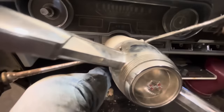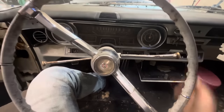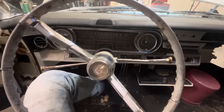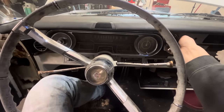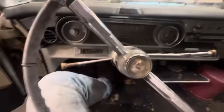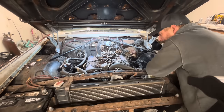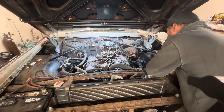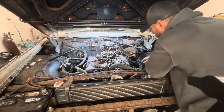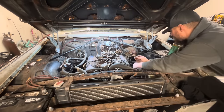Must be my neutral safety switch, but as you can hear — she's turning over with the key! Nice, this is awesome. That turns over pretty good. I'm going to tackle the spark issue and then we'll start tackling the fuel. I'll throw a little spark tester on one of these plug wires and we'll see if we're getting spark to the plugs and if this thing lights up for us. I don't think I see any spark there — that little tester isn't lighting up, so we're going to have to dig into that.